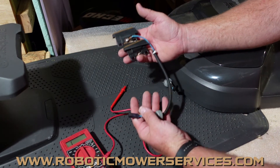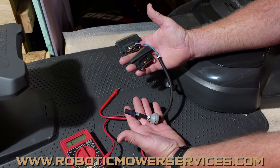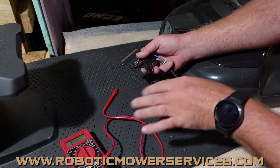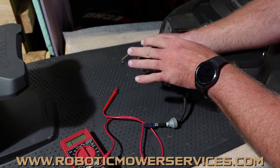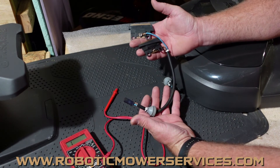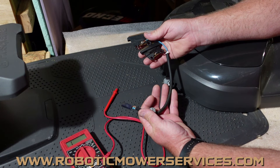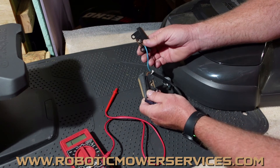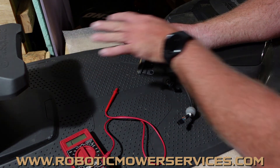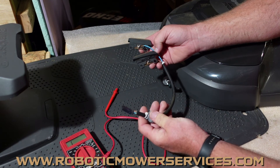Hopefully that helps you guys out, because this is a component that's involved in no-charging issues and in the new charging current supervisor feature — where the mower goes into the charging station, sits there for about 20 seconds, backs out, wanders around a little bit, tries to dock again, backs out after 20 seconds, and then finally gives up and says there's a charging station error or the charging station is blocked. This component can cause an issue with that because the charging current supervisor is looking for a certain amount of charging current coming through. If you have high resistance in one of these wires, that is going to keep the battery from getting the proper amount of charging current and cause the mower to back out and not dock properly.